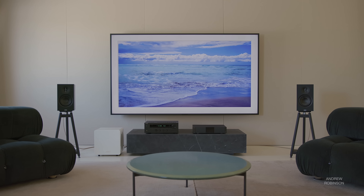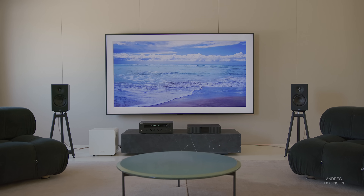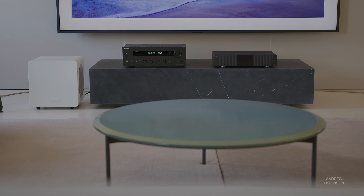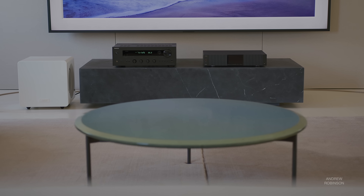All things considered, the Onkyo seems pretty feature-packed. The setup is straightforward, if not actually a little more basic than I was expecting. I connected the Onkyo to two different displays: TCL's new QM8 and our reference Sony X90L. As long as I relied on the HDMI ARC connection with the TV's audio output set to PCM, the Onkyo worked great. Just remember, no sound will pass through if you leave the TV's sound setting to anything but PCM, so be sure to bookmark this video if you end up purchasing the TX8470.